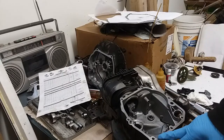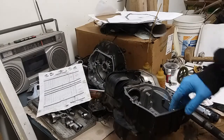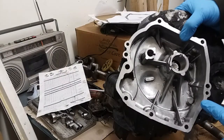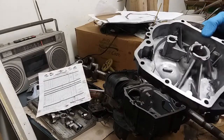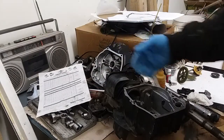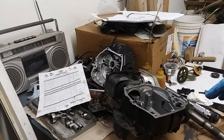I prepped this by scraping off all the old gasket material and cleaning it up with a Scotch-Brite pad. I also did the same thing to the sump that came off of the Super Recycler - cleaned this all up, tried to get it as clean as possible. Now basically I'm just going to go through the steps for doing the reassembly.